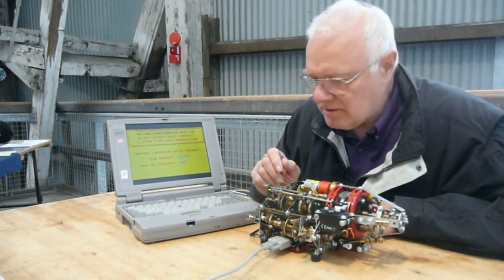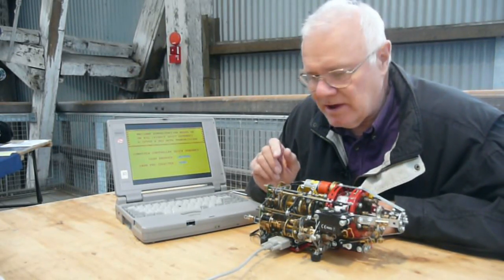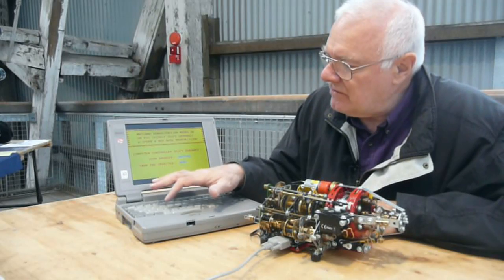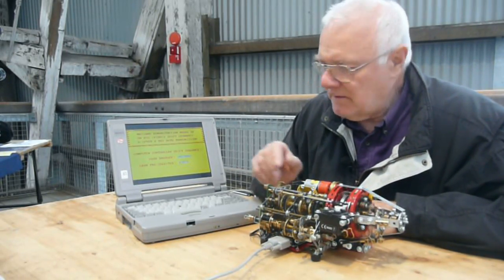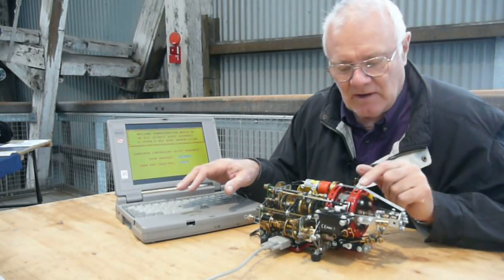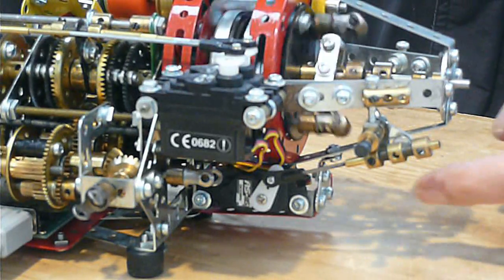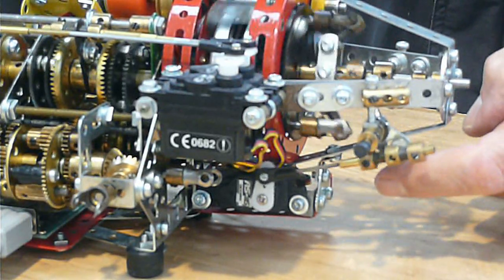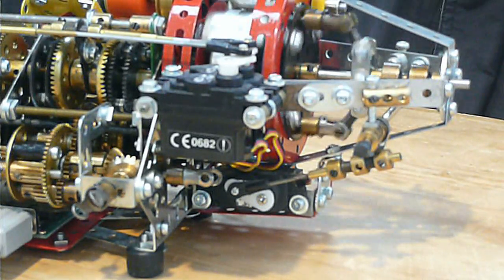On the screen we're showing that we're in neutral, so there's no output drive and no gear is selected. The next event is to pre-select first gear, and then to cause the vehicle to move off we switch to the clutch which is driving the odd ratio. You'll see the toggle mechanism of the clutch move — now the gearbox is in first gear and we have output rotation.